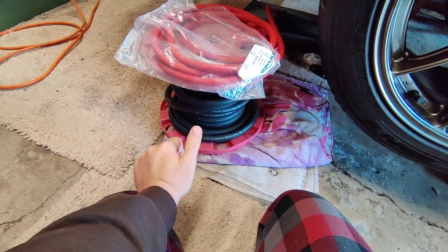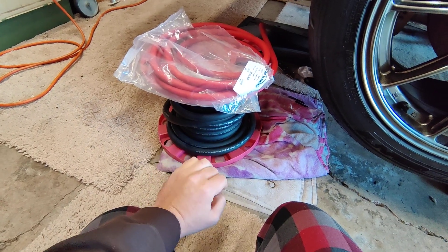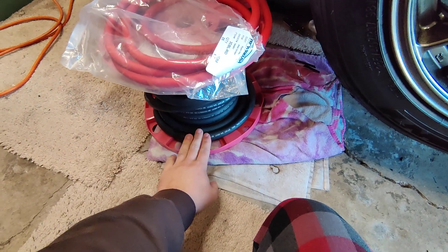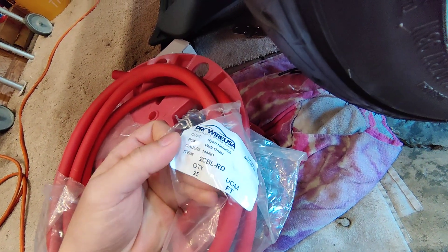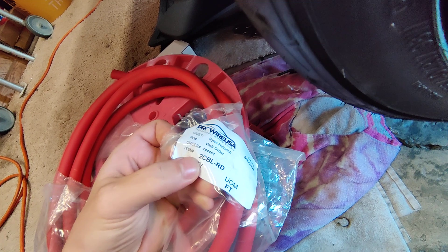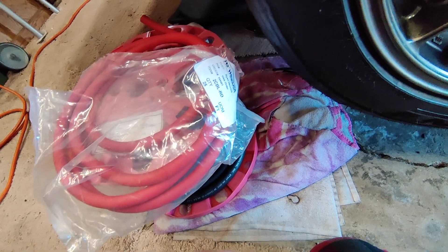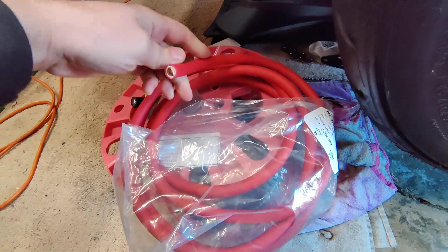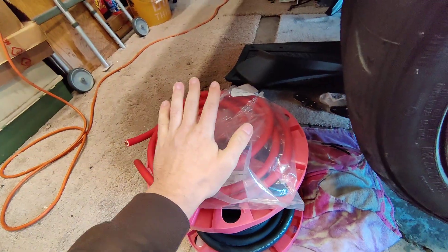I have a big amp that handles about 150 amps, three fuel pumps, four fans, stuff like that. So I'm Captain Overkill. ProWire USA has a really great two-gauge — this is two, and this is 00, so it's two slash zero. This is a really nice, double-shielded, very flexible for its size wire. This will handle most of your cars. This is what I use for my PMUs, and the PMUs are direct to that.